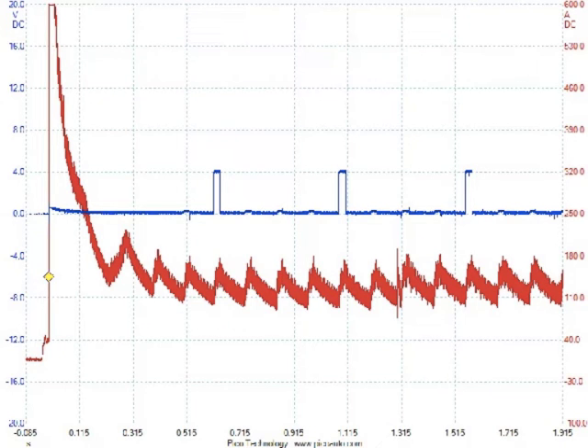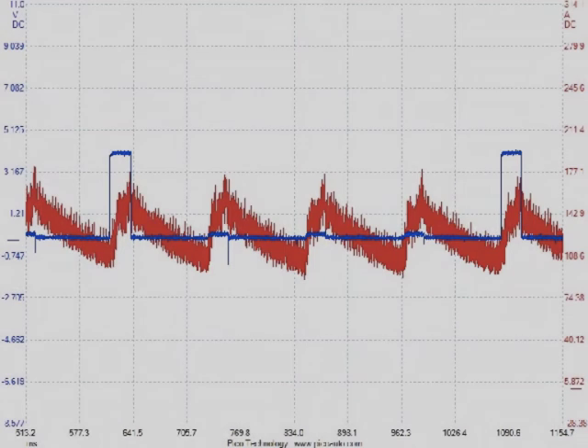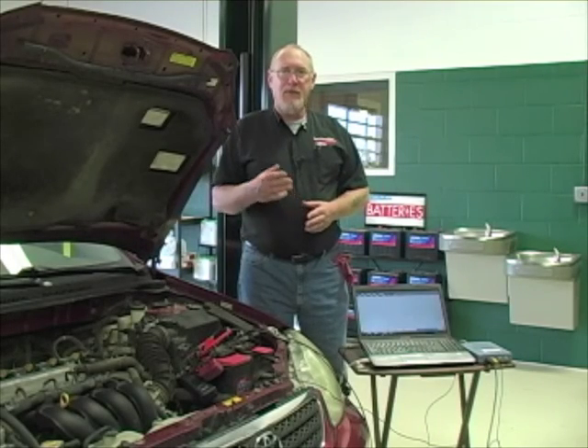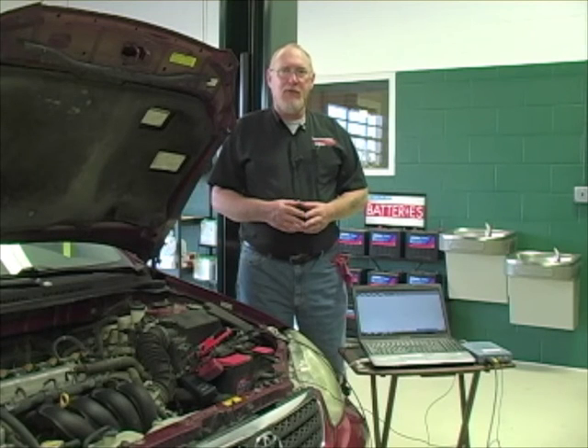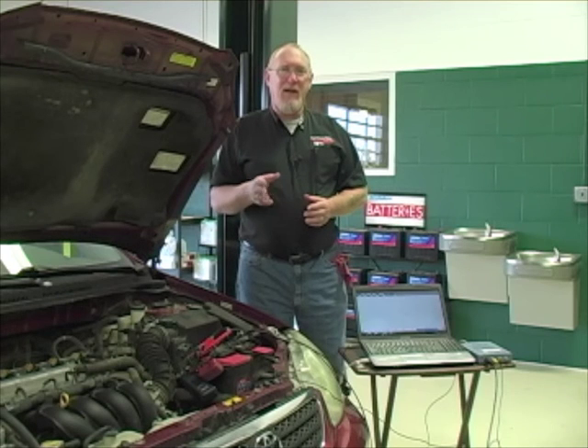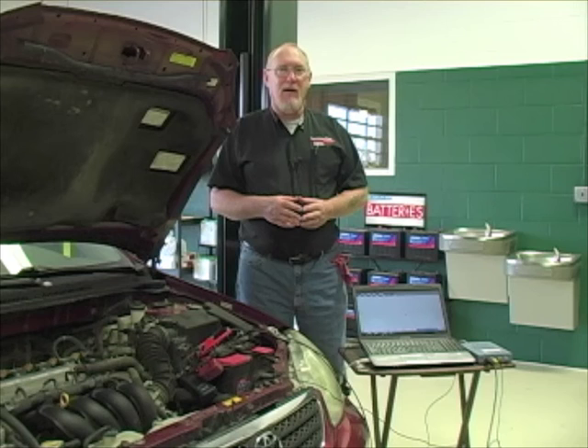Now I know what cylinder goes with what peak. What else can I learn from this waveform? Did you say timing? Sure — if the timing were off, that reference line would be further away from the peak one way or the other. And I didn't even need a known good pattern to compare it to. These are just a few examples of how a scope can help you speed up your diagnostic process and find those tricky problems more quickly and efficiently. I hope you've also seen that a scope is not as complicated to operate as you might have thought. So blow the dust off the one in your shop and give it a try. If you need help, we have lots of resources on the AutoPro Workshop and the MotorAge.com website, and you can ask questions in the comment section of this video. That's all the time I've got for this month's edition of The Trainer. I'll see you next month.